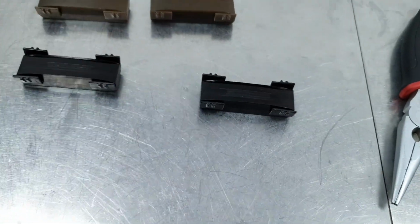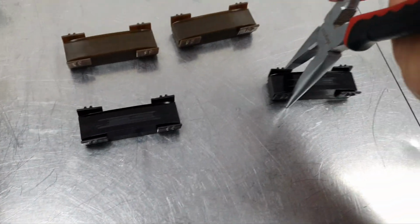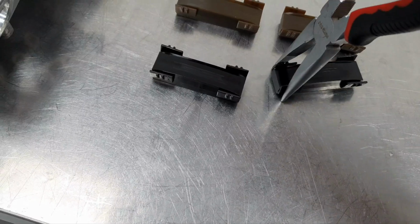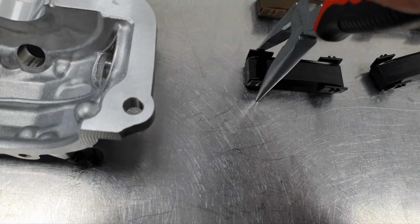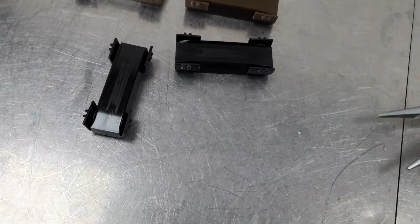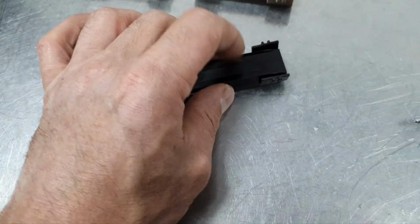Now, these guides, they're not burnt. That means when I squeeze it once to take it out, they didn't broke these ears here. And even if I push it more, you can see that I'm squeezing it hard. All right, you see that's not burnt. Usually, like I've said before, the same thing like the 157, these ears, it's very easy to break when it's burnt. All right. Now, there is not crazy wear on the guides, looks nice.